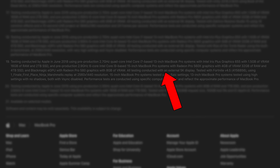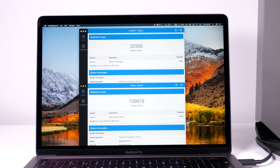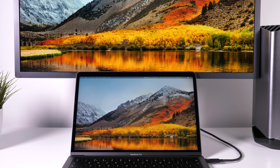After ending the video, I wondered why Apple was showing big Fortnite improvements when I saw none. I noticed they were testing with the LG UltraFine 5K monitor connected. Here's what I discovered: even though you can connect the eGPU to the MacBook directly and apps that support it will use it, apps that don't support eGPUs won't use it unless a monitor is connected directly to the eGPU and the eGPU is then connected to the Mac. That's when macOS forces the eGPU to be used. Everything needs to be daisy-chained — monitor to eGPU, then eGPU to Mac.